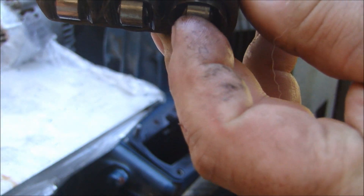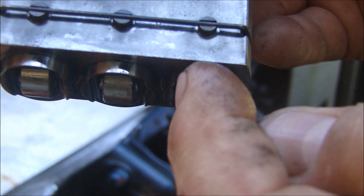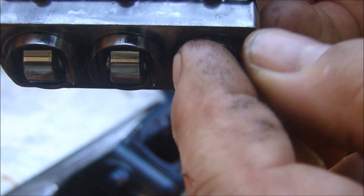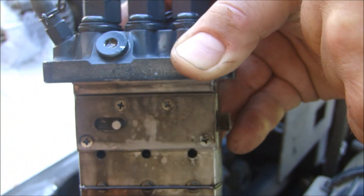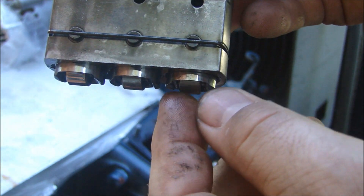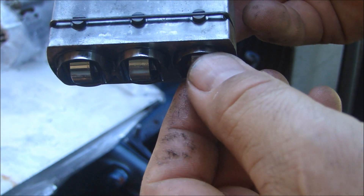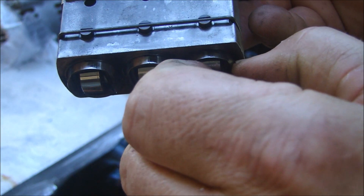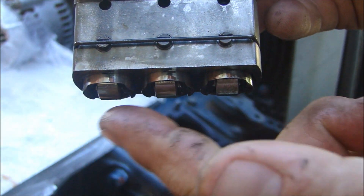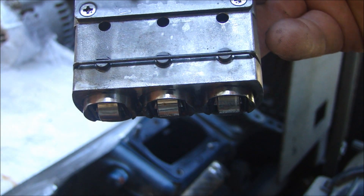This one here is real soft. You can see how loose it is — these others are nice and firm. So the spring in here is shot. Which means this cylinder, the one in the back, was not getting enough fuel. At high RPM, it wasn't returning far enough to suck enough fuel in and pump it up to the cylinder. When you have a spring that is damaged or worn out and it's not pumping right, you're not getting enough fuel — that's how you lose power. This cylinder's not getting enough fuel, the other cylinders are getting too much, it overloads, you start blowing smoke, and this cylinder runs lean. That's what happens.